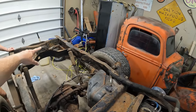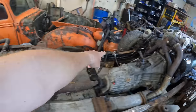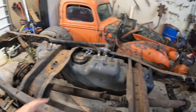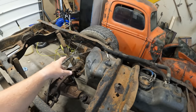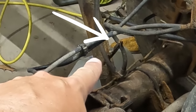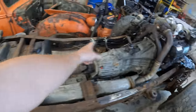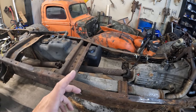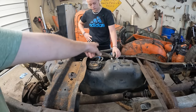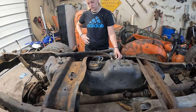The wiring harness that ran the rear lights and trailer lights — that whole wiring harness, the loom that goes through here — we're gonna have to strip that out. We're gonna disconnect the fuel lines, drop the tank, and then basically back here where the vice grips are holding that rear brake line shut, we're gonna cut from there and remove the brake line all the way up through there. I think we're gonna leave the fuel lines because they still look like they're in good shape. I need you to just take all the hoses, electrical connections, and everything off the top of that. There's like six there, seven there. I don't know what I'm doing.